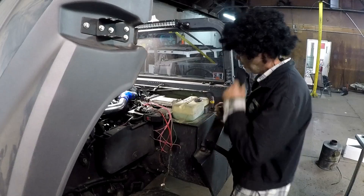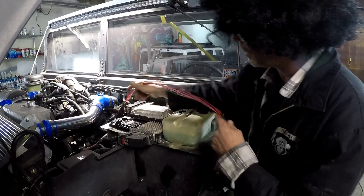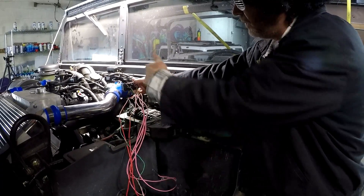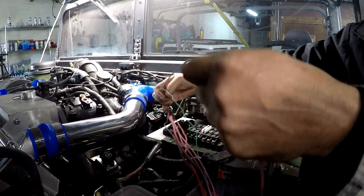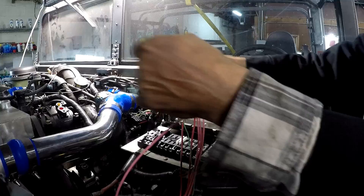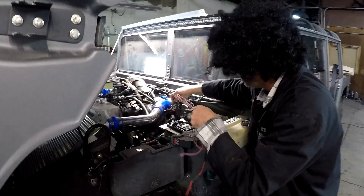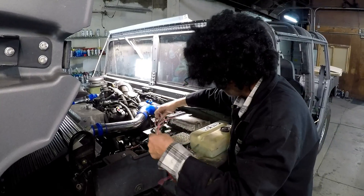At this point we've stepped into the electrical. In the kit you're going to already have this modified harness — it won't have the old X109 connector on there, it'll already be terminated. Since this is our newest version we always leave string lines on things. They've separated the power: these pink wires are switched ignition, the red ones go to battery, and this black one is ground. Pretty simple. It will be terminated and cut to length.